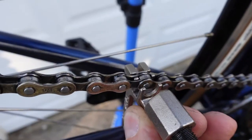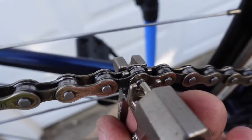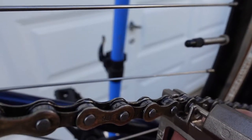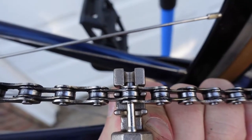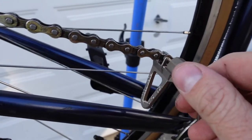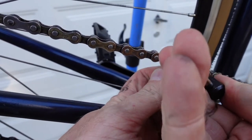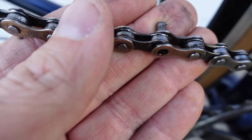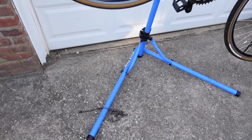The chain fits right in there. Now we want to make sure this is straight — this is how I broke the pin in the first place. You can see how the pin is sitting right against the chain pins; the chain has a bunch of pins inside the rollers and we want to be pressing as straight as possible. We're just going to gently push it through. Feel a bit of resistance — see how it's pushing that center pin out a little bit, that's what we want. You should feel a lot of resistance at this point because the chain can't come apart easily — you don't want the chain falling apart while you're riding. And there we go, old chain off.